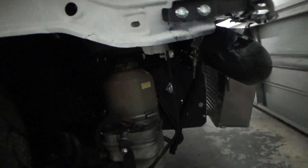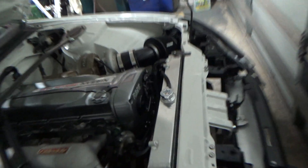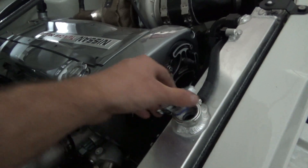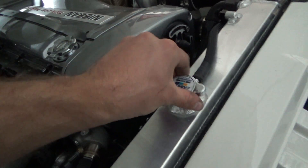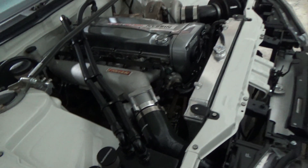At least that will be done. Next up will be the power steering pump — just unbolt that, put it down on a jack, and just power it up. Once I power it up I'll be able to bleed it and get it feeling not too bad. Fill it up as much as I can with LDS. The radiator is pretty full — once the car's running I will top that up and give it a proper bleed. The cap can stay on there so I don't lose it. Yeah, we're at a point where we're nearly complete. The next video will be the car driving, so at the moment I'll just do all the final button-up bits in this one.